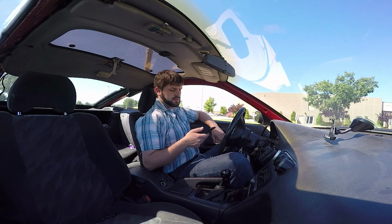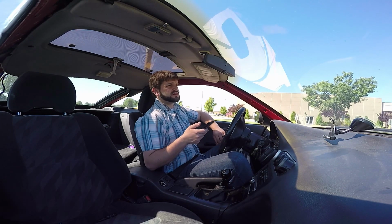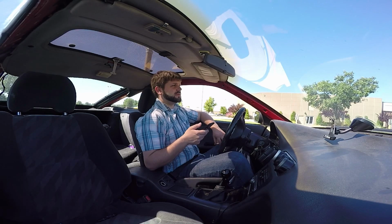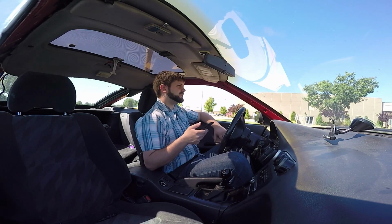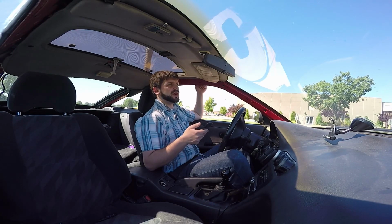I'll add a few other things. Main engine, everything's set, you're looking at $4,000 for the engine and transmission. Make sure it's a front sump. A mount kit is $300 or so. Drive shaft, let's say $500, or $400 for a one-piece aluminum. If you don't have an LSD differential, you're going to have to grab one of those. Charge piping from eBay, or have a shop do it.